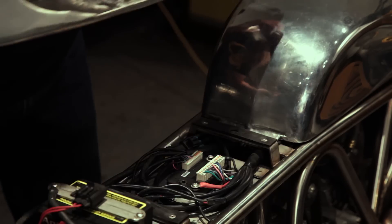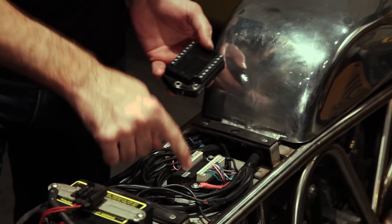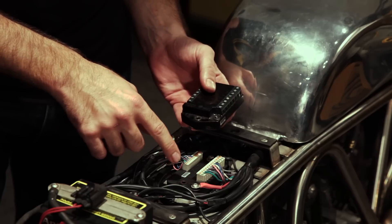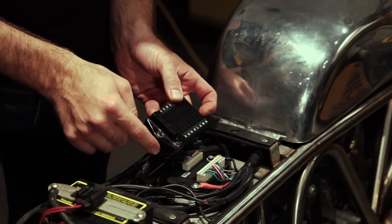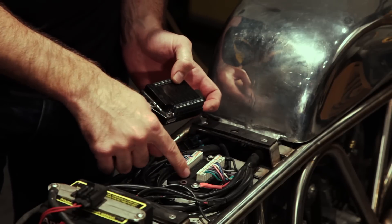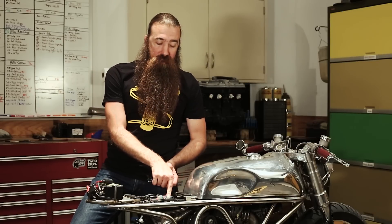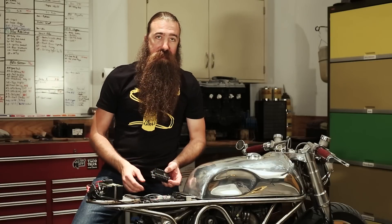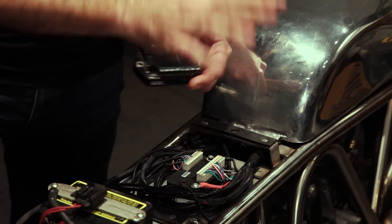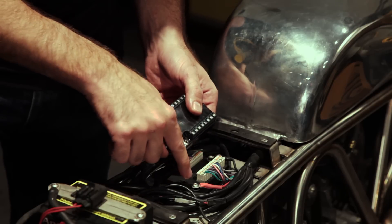What we want to look at is what's underneath. I've replaced the original M Unit that was in this bike with the brand new M Unit Blue. It's worth noting a few differences: most notably the mounting bolt spacing is different — the M Unit Blue is a little bit narrower. In this case I've only used one mounting bolt just to hold it down for this demonstration. If I was actually making this upgrade I would drill a new hole, tap it, and then I'd have two mounting points — no problem.